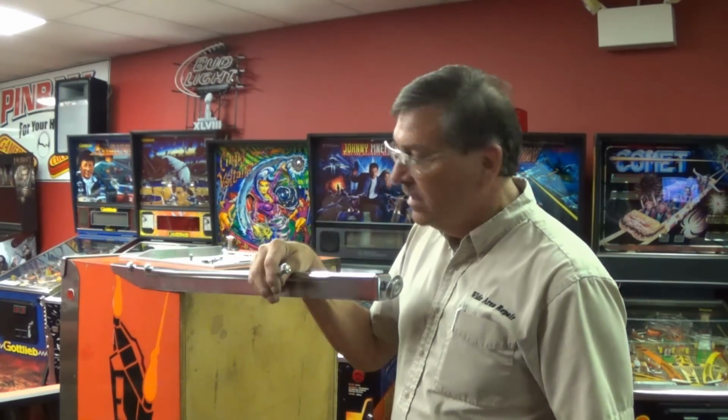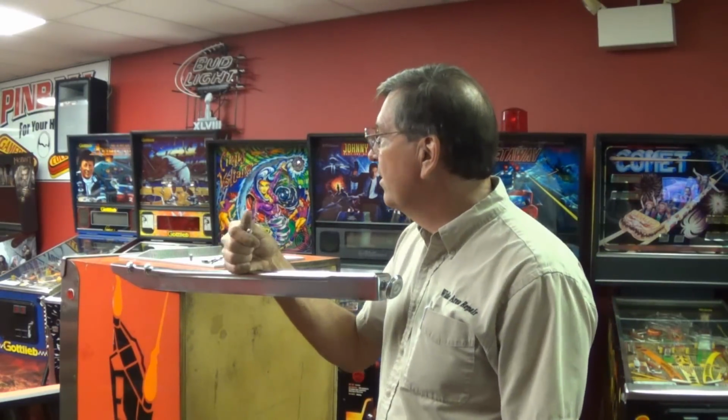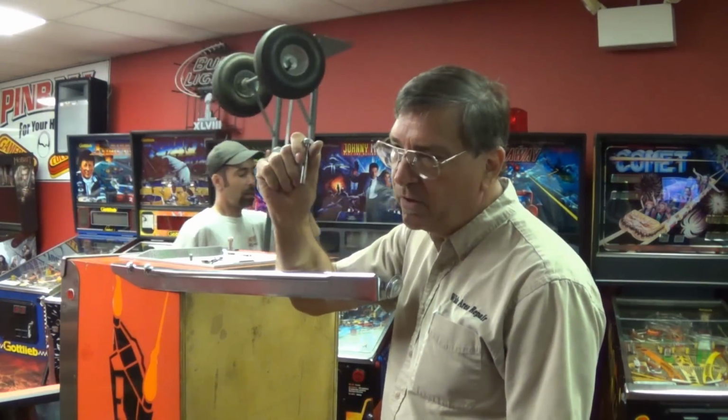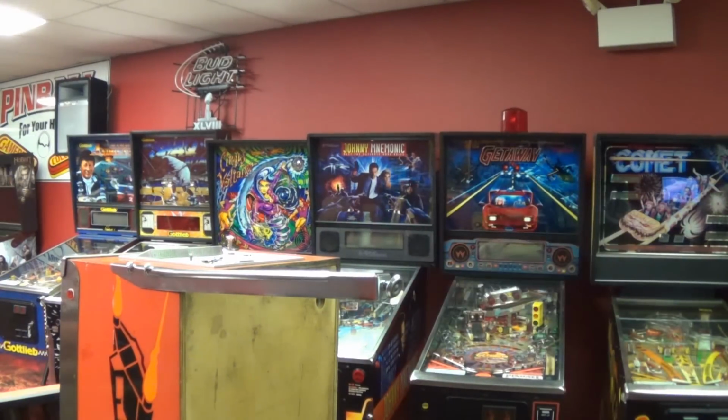So, anyway, you can use impact tools on these if you want, but be aware, these are grade 2 bolts. It shows that you're in a hurry and you're going to have a problem. Be aware, bolts are graded by hardness, by the way. A grade 2 is a very soft bolt.